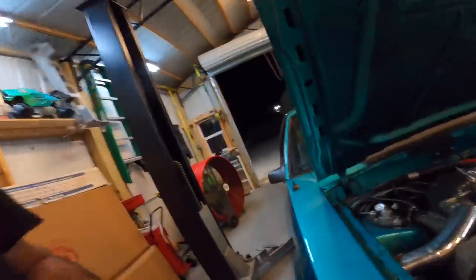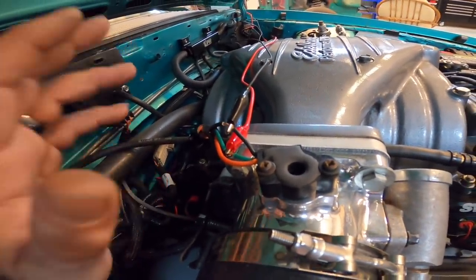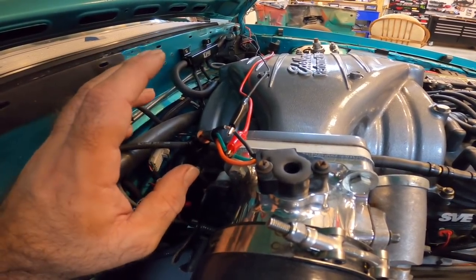There's no need to drag you along for the whole setup — I'll catch you guys in just a second. I actually took my new TPS off and put my old TPS back on because I want to show you something. So this is what I came up with to show those of you with a stock computer car who want to test this theory — to see if your TPS is jumping all over the place while you're driving.